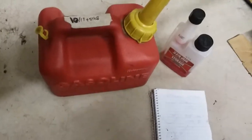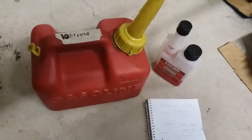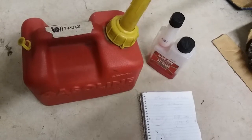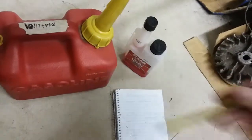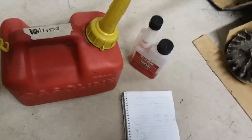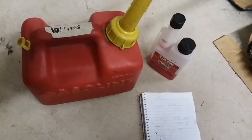That would be the other option. Any tools that you're not going to use — whether it's a mower or snowblower — for an extended period of time, run out the fuel that's in there. If you have to, drain or siphon off the tank into a container if you have a lot in there. Ideally, don't top it up when you're getting towards the end of the season, and then just run that tank empty.